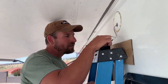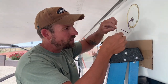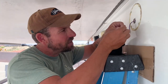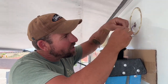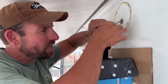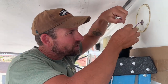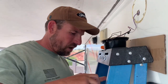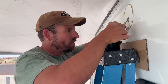All right, we're on top of the ladder. All speakers are going to come with some sort of speaker wire to the head — just cut a piece off that you think you need, strip it off, and then strip off the old one that comes out of the RV. Really simple — twist them together. Now the one in the RV is a thicker gauge wire than the one you're going to get at AutoZone or any parts store, so you always wrap the thinner wire around the thicker one and bend it back over.